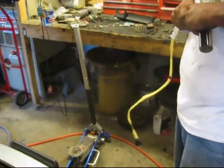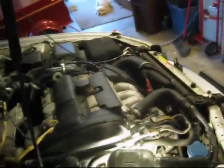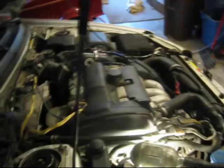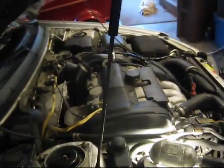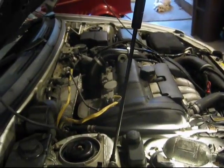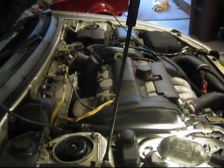And after that, I don't have the OBD-II reader here with me, but after we replace this, we should clear out the codes on the check engine light, to reset the fuel trim levels, and then hopefully it'll work, but we'll see. It could be that that little harness is bad or something like that, but hopefully not. But that's all I got for today.